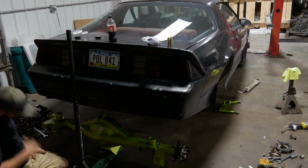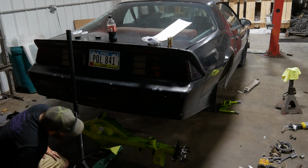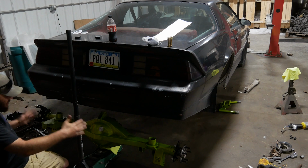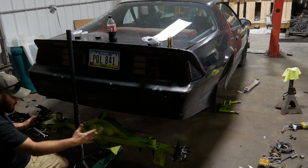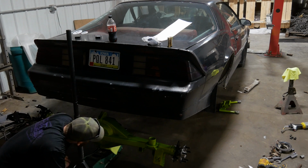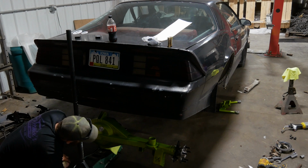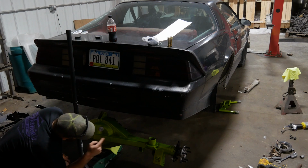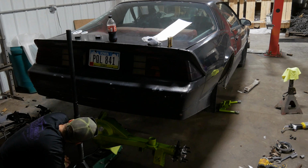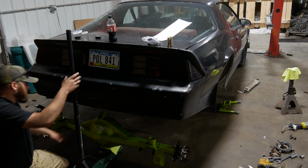So my plan is I'm gonna get this thing slid into place, hook up my lower control arms, now kind of help stabilize it, and then when I took this off, the shocks really held it up, so I think I'll set our coil springs in there and then work on one end to try and get our shocks bolted in, and that should hopefully help.